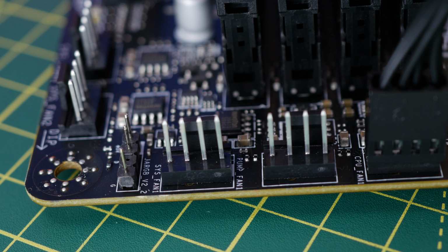and that's how you connect a single fan. Obviously, you're going to want to connect more fans than that, so I'm going to show you how to do that in a really simple way. Now, with the triple pack or the twin pack, you have the RGB controller included as standard, which can take the RGB connection for 3 fans. So 3 fans can be plugged into it and then controlled via NZXT's CAM software.